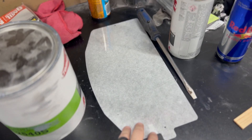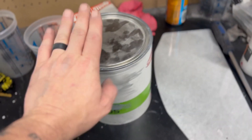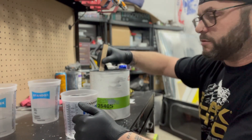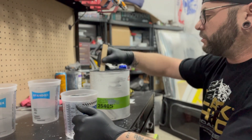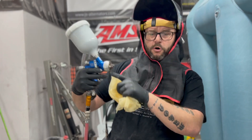New sheet out for the mask, air-fed mask, mandatory Red Bull. Now let's get this mixed. Obviously with any sealer, make sure you thoroughly, thoroughly mix the tub. If you guys want me to go into more detail about all the clears and primers we use from England, any of the base coats, just comment below and let me know - it is a lot different to some of what you guys may use over here in the States. Set up the sealer, DeVilbiss again, 1.4 TE10. DeVilbiss air-fed mask. Tac-rag wiped down - shoot a couple coats of this sealer.